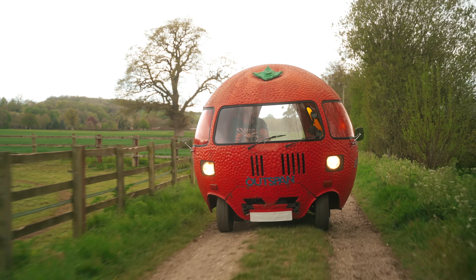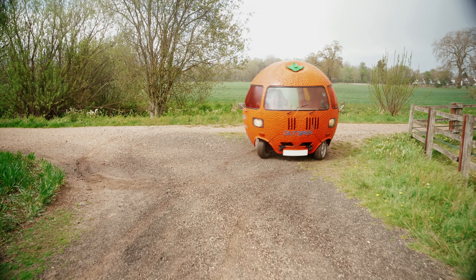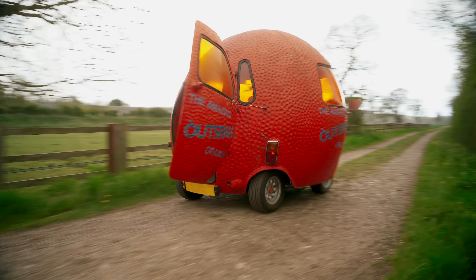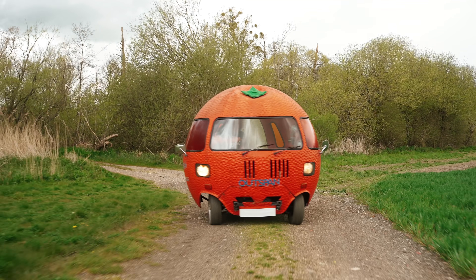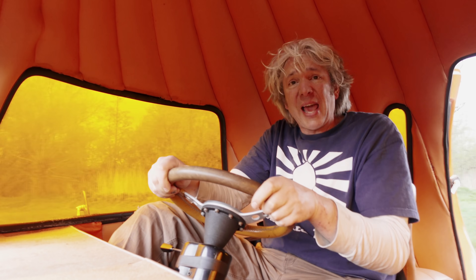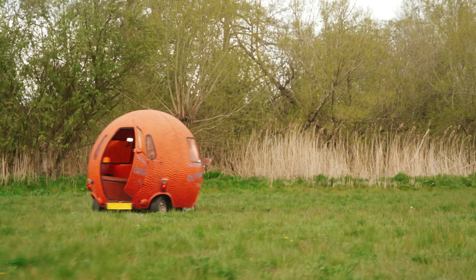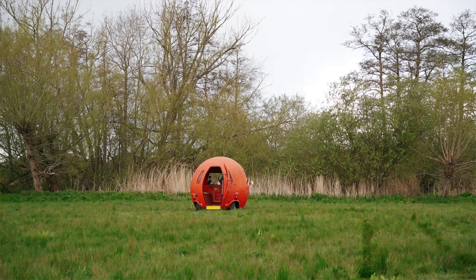It's just bags of fun, really — a bit of orange fruity craziness. You can dart backwards and forwards, it's so responsive. I don't think it would take much to get a couple of wheels off the ground, but then you'd end up potentially rolling it and that wouldn't be quite so much fun. The steering is fantastically responsive, really good fun — but the only thing is it pulls to the right. If I let go of the steering it literally goes straight into the middle of a field, which is obviously not ideal. I know it's not the tyre pressures, so it's probably something to do with the steering or the geometry of the suspension. The steering is adjustable via the track rod ends, but the rest of the suspension is pretty much fixed at the factory, so it could be quite a difficult thing to solve. I've got lots more work to do in the workshop.